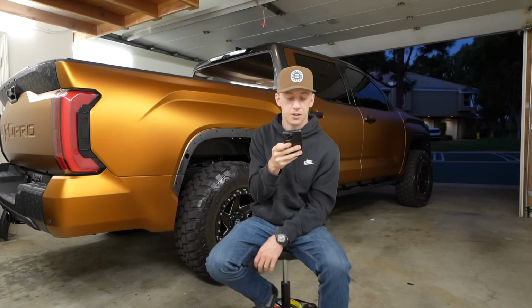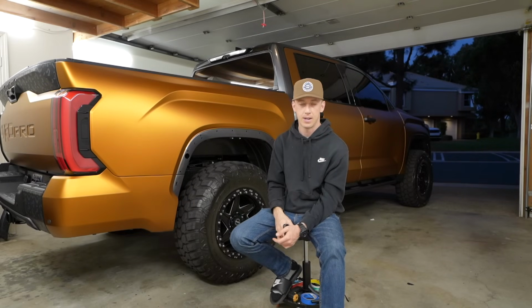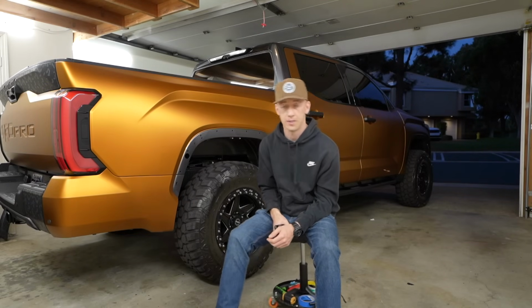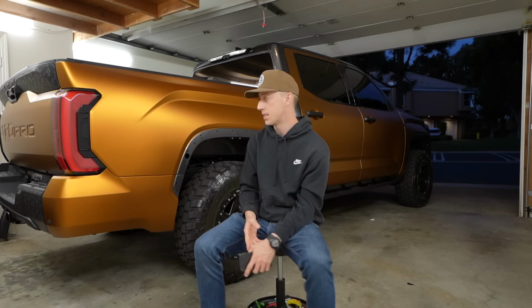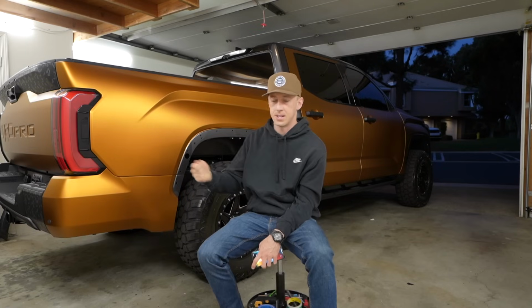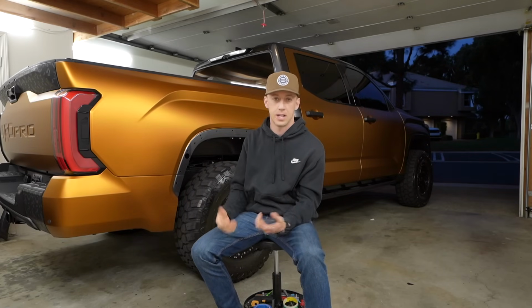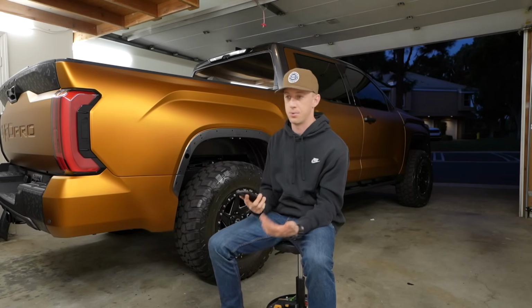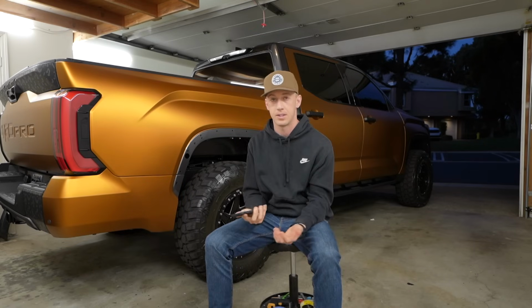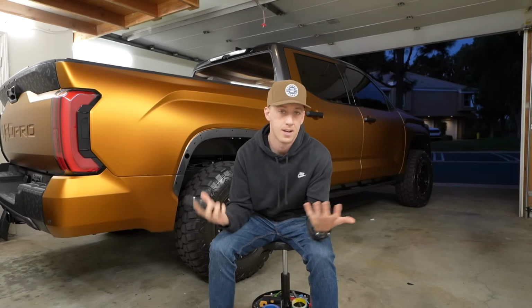Bro, you make it look so easy. I'm too scared, LOL. Honestly, just buy some practice material. Wrap's actually very forgiving. When you're laying down a panel, say for example, if I'm laying down the wrap here on the bedside and I mess it up, I wrinkle it, whatever, you can pull the wrap up and then heat it up and it gets rid of all of the issues you just put into the wrap, like all the creases and stuff like that. So honestly, don't be scared. You can retry the same film like 10 times over and over.